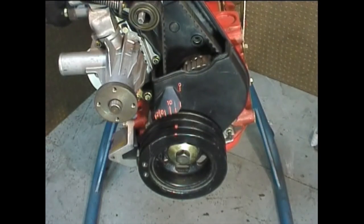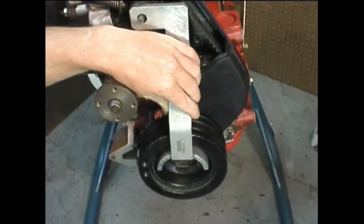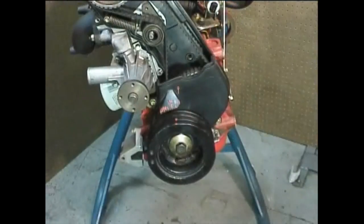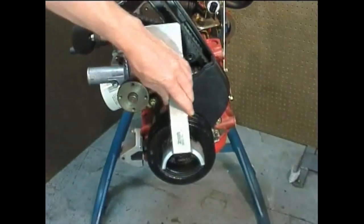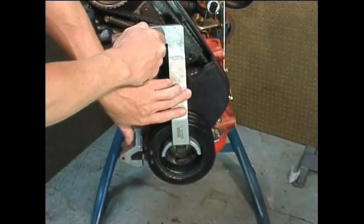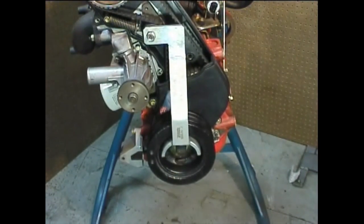The next step is to take off the 24mm crankshaft bolt. You'll need to hold the crankshaft still to do this. For engines 1985 and later, you can use IPD Tool part number T5284. For earlier engines, a chain wrench or impact wrench works well. The next step is to install the counterstay, using the existing nut from the timing belt tensioner. Once it's installed, use a 24mm socket to remove the bolt.